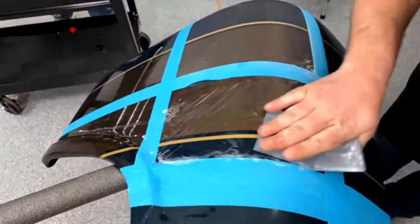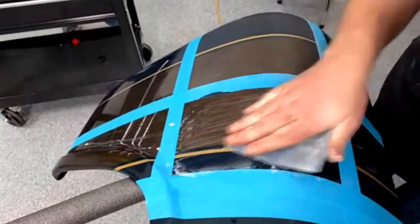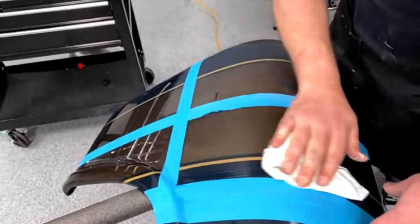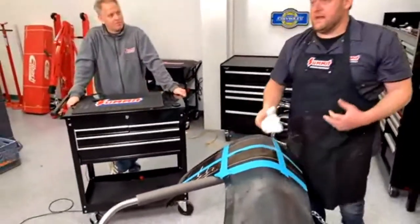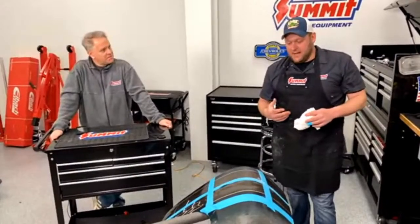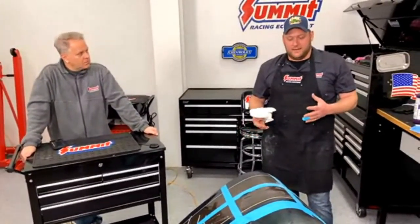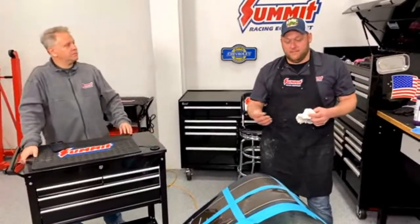You were talking a little bit earlier too about, for this, having the color come out is bad. Maybe with the epoxy, is it an enamel type finish? It's not as big a deal. Honestly, if you're doing an enamel paint job, enamel would be like single stage. If you're doing a single stage paint job, I would still suggest clear coating it. You're going to get the best bang for the buck from clear coat. It's going to last longer, and it's going to look better because you're going to be able to wet sand and buff. It's going to be a lot deeper paint job.